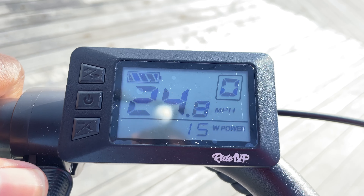Being that there's no weight on the bike, it's not taking a whole lot of output from us — but right there we're using 102 watts just to propel the rear wheel. After that we have the max speed: since we turned the power all the way up, we got the rear wheel up to 31 miles per hour, and the average speed while the wheel was spinning calculated to 22.7 miles per hour. Again, pretty versatile and well-equipped, especially for a bike at this price point. Definitely one of my favorite features.